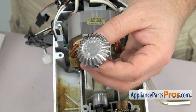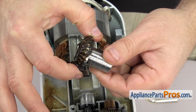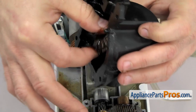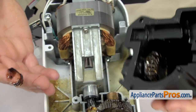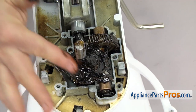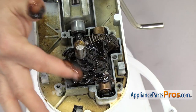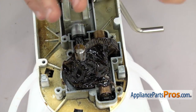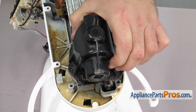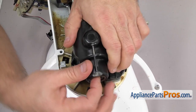Now we can put some grease on the accessory drive gear — just fill in all the teeth. Once you have the teeth lubed up, we can grab the housing and drop it in there. Once you have it in there, we can set it aside. We're going to take the extra grease and kind of pack it around the whole area and fill everything in. You don't want to put any of this grease into the housing — you just want to build a cone up around the shaft and all the gears. That way all the grease is on the gears and not up in the housing where it's not hitting anything. Once you have it in place, we can put the housing back on. All you have to do is line it up and flip it over. Once you have it lined up, you can push it down into place. If it won't go down all the way, you may have to turn the little hub attachment so it lines up with the beveled gear.